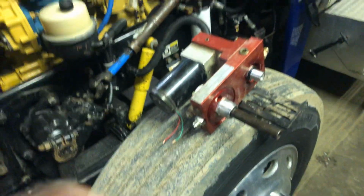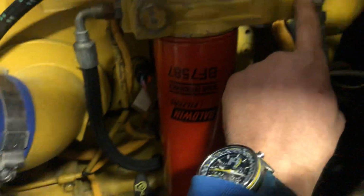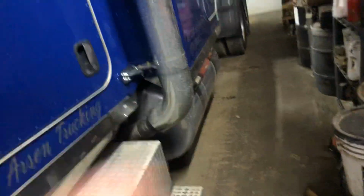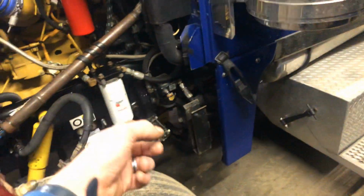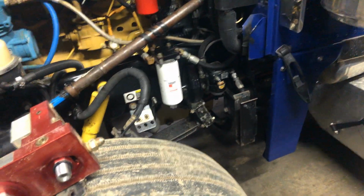Basically what it does, it's polishing fuel and, you know, cleans your fuel out. But I got a pressure coming out right here too, and it's pretty high pressure, so I don't know if I can tee this out, or I have to run completely different lines back to the tank, split them out up there underneath, and then do it this way. But like I said, I just built that pump, basically made like a homemade Fass system, and I didn't even drive the truck yet.